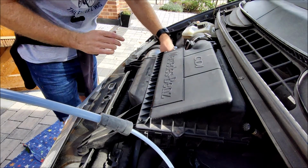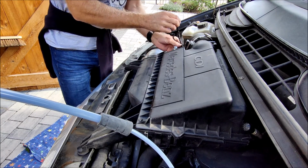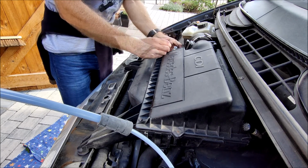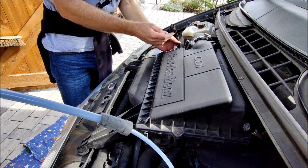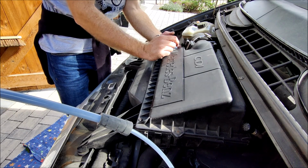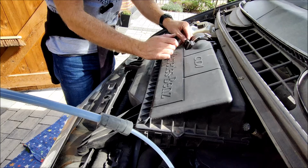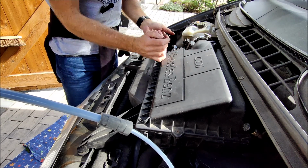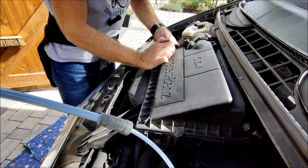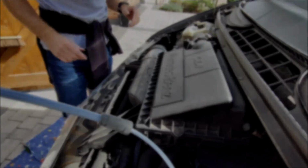That's good. And then you've got your sensor wires to reconnect. So take your two sensor wires. Okay, so there's your two sensor connectors. Clip your cable retainer back onto the side of the airbox. Push in your connectors, push the grey clip back on that one, lock it in place. Push that one in until it clicks. That's your airbox all connected back up.